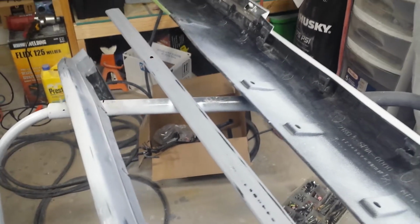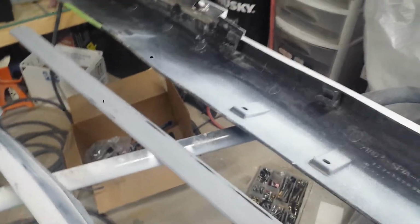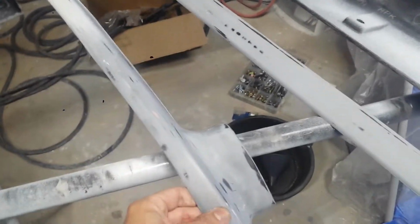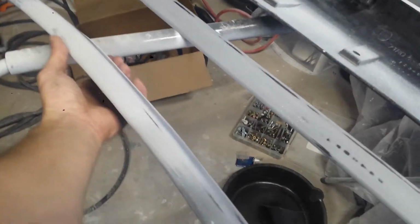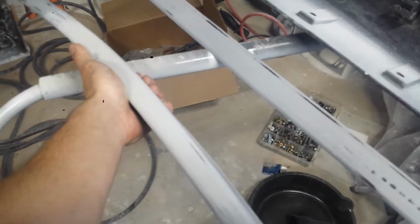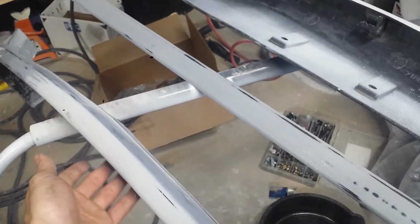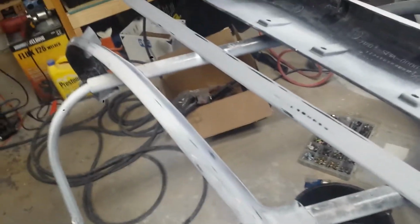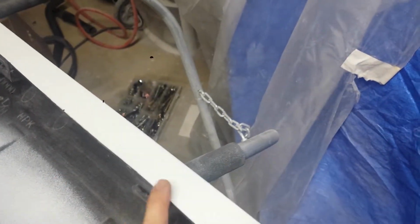I have to use the primer filler from Summit on this, because this primer filler holds very well. I tried to bend this on purpose because of this. It got heated a little bit with how hot it gets outside. And this spray type, it is a 2K. It's not a lacquer base, but this spray primer filler just started showing stress fractures and lines. I'm like, oh, you know, I'm just going to do it right. And this piece technically could be done, but like I said, OCD.